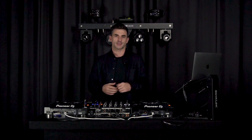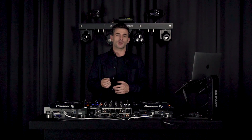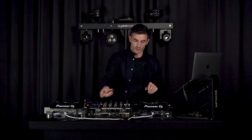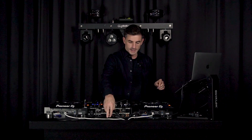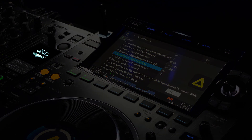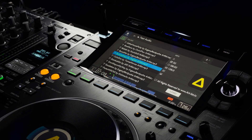So how does it work? Basically the mixer will calculate the BPM of the audio coming through on the fly and will convert that into a BPM clock — a time signal or timestamp — that is sent from the mixer out through USB and into the computer. The first thing we need to do is make sure that we have the USB port connected to the computer. You can also see on the display that there's a BPM being read, and on the players there is also a BPM display.